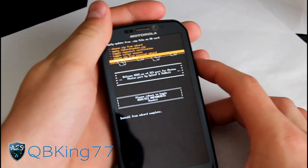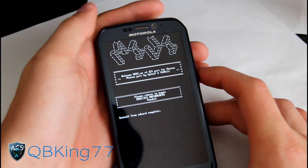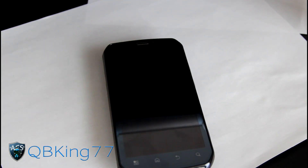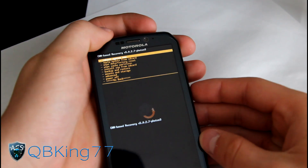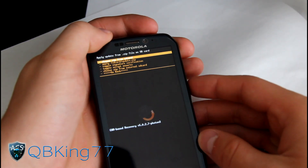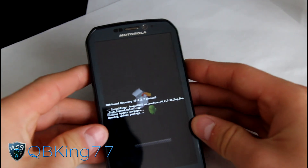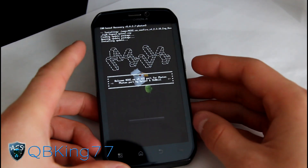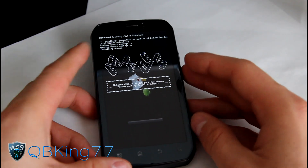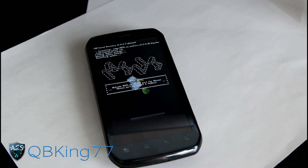What we're going to now need to do is hit 'Go Back' and then go to the Advanced menu once again, and hit 'Reboot Recovery'. What that's going to do is reboot your device back into Clockwork Mod recovery. It should reboot you into your custom recovery. Now go back to 'Install Zip from SD Card', choose zip from SD card or internal SD card, select the ROM zip again, and install it again. Be patient with the second install process — I'm guessing it will take a little bit longer.